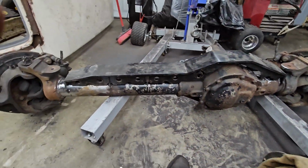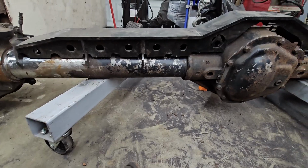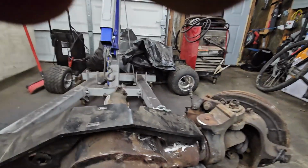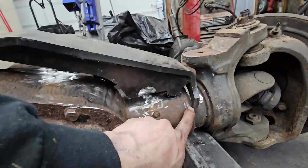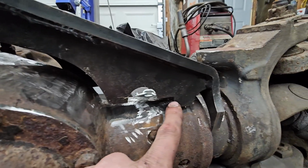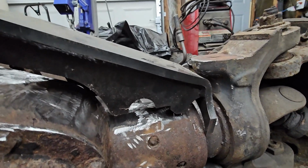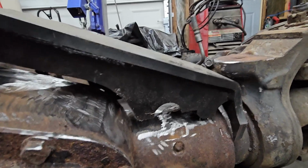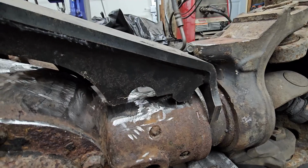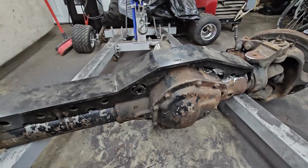So, this is my truss. This is Artec Industries Low Pro truss. This is why you have to cut the 2 inches off, because you want this little lip right here to sit against the cast. So at this point I have to go through and cut my couple inches off of there, and then this truss should be ready to set down on there.